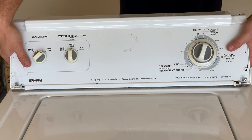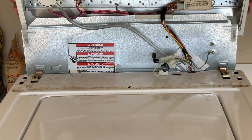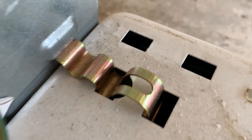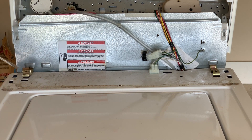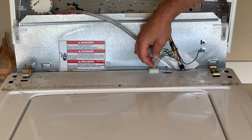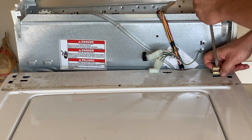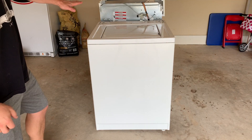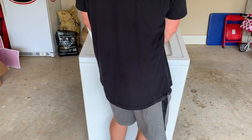Once you get them loosened, you can grab firmly from the back and it should lift up. This whole thing can rest right here on the back just like this. The next step is to remove these clips — there's one on each side. I'm going to put my screwdriver down in here and lift forward while I'm lifting up on the hinge and it'll pop right out. Before I unclip the second side, I'm going to unclip this connector — it should just lift up and pull off. That's the connector that goes to your lid switch. With both clips out, I can open the lid, stick my hands inside, and it simply lifts off.